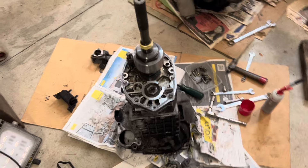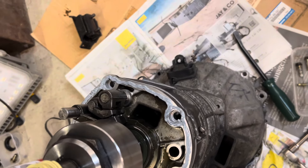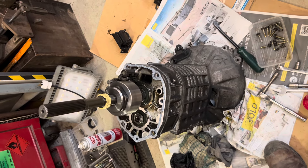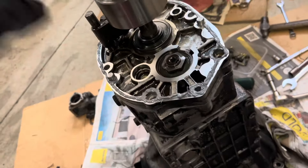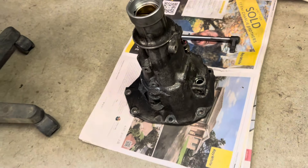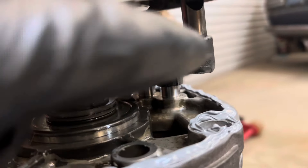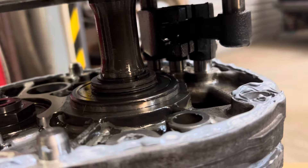The tricky part now is dropping the tail shaft housing down with the selector rod into these knuckles. I won't be able to film this part unfortunately, but if this is the kind of stuff you guys want to see or learn about, just let me know. It really is just the long bolts coming down that hold all of this together. I've pulled the rear seal out so I can replace it easier later. The shifter rod that goes up to your gear stick - when I drop this tail shaft housing down I've got to make sure it doesn't knock it into gear. That's the tricky part.